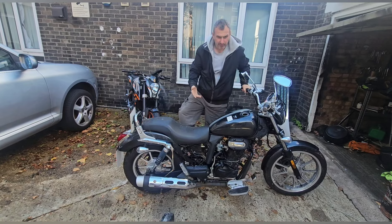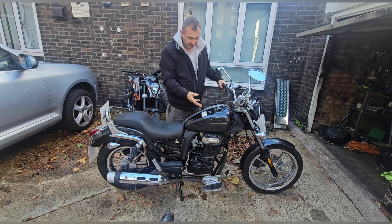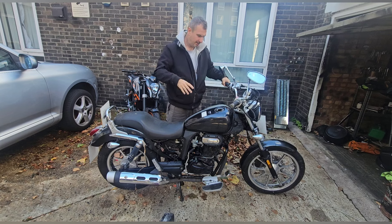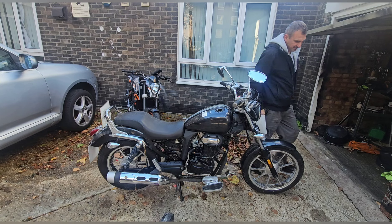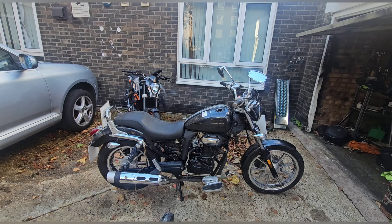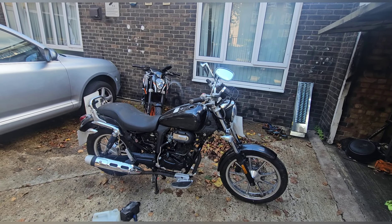We're almost using this fuel to clean out the tank. It wouldn't hurt to drain the tank again next week and start fresh. Carb off — let's get the carb off, let's do a carb clean. I've got brake cleaner I picked up last week. Make sure to drain out what's in the fuel line, because otherwise you put the crap straight back in the cleaned carb.